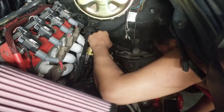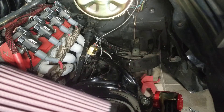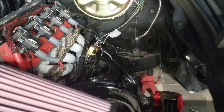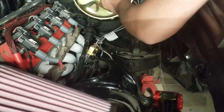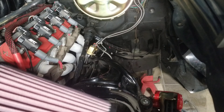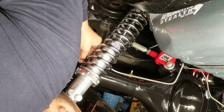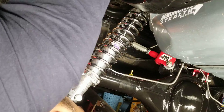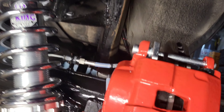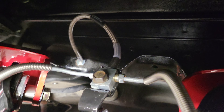The line will basically go like that — it'll be inside that hole. I'm going to assemble all that and go over it again once it's all laid out. This is just mock-up right now. I want to get this caliper mounted to where it will be so I can figure out where to mount these tabs. I'm going to have to weld the tabs to the housing.